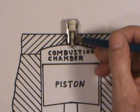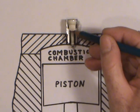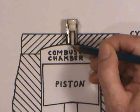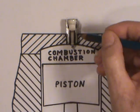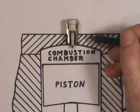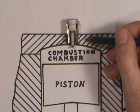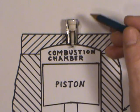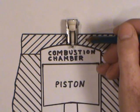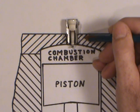What you see here is the metal shell cut away so you can see the porcelain inside the spark plug. There's the firing tip, the electrode inside, and the outer electrode. The heat has to find a way from the combustion chamber to cool itself down — it might still be around 200 degrees depending on the head temperature. The heat transfers up through the porcelain, then through the shell, and the cylinder head absorbs that heat.